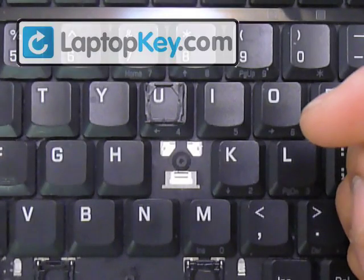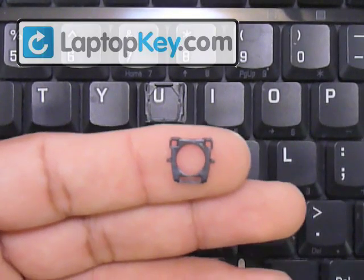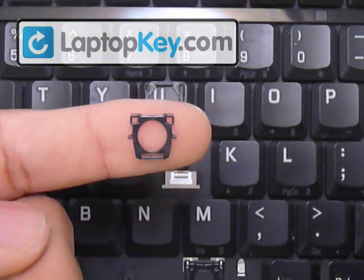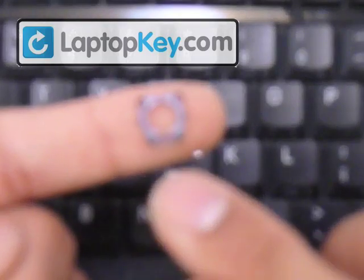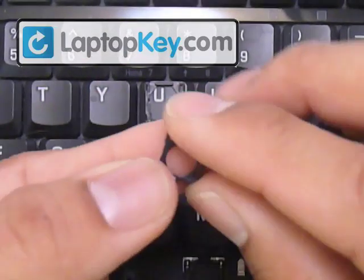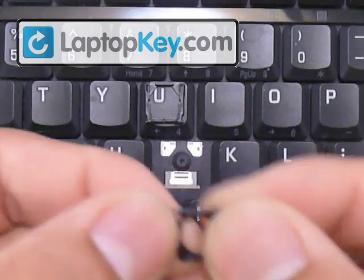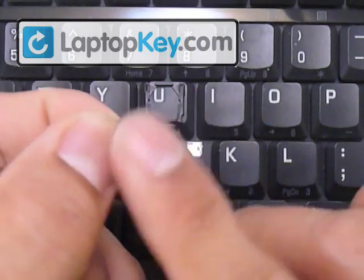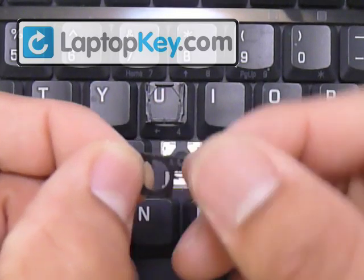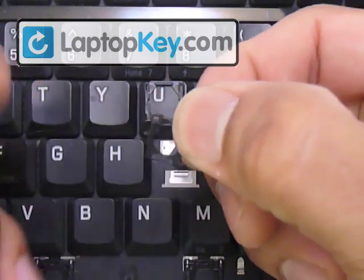Put it down for now and get the next piece. It has two pins in the middle so it can click onto the large piece, and two holes at the top that are going to grab onto the keycap. But this bar at the bottom is going to go under the large hook — that's how you know the correct orientation. Then make sure not to put it upside down using the same technique: feel the entire hinge, and if it's one smooth piece from side to side and top to bottom, that faces away from the keyboard. But if you feel that the bottom is standing out more, that side touches the keyboard.